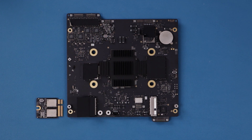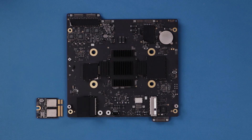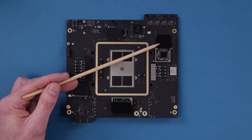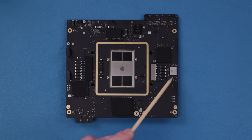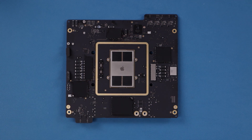In this corner we have the USB Type-A ports as well as chipsets and controllers for those. Next to it we have the CMOS battery. It's actually a solid piece of metal so we are unable to take a peek underneath that. On the other side of the logic board, right in the middle, you can see the M1 Max chip. Since we have the model with 32 gigs of RAM, each of these chips is 8 gigabytes in capacity. On either side of the M1 Max chip we have two Apple chipsets for power management. Over here we have the Wi-Fi and Bluetooth controller, and over here we have the 10 gig ethernet controller. And that's about it for the logic board.